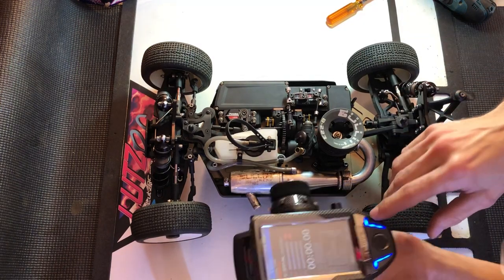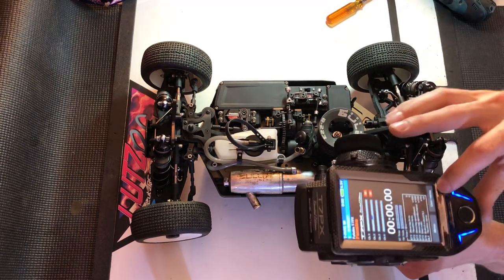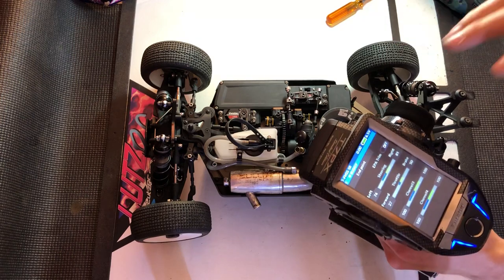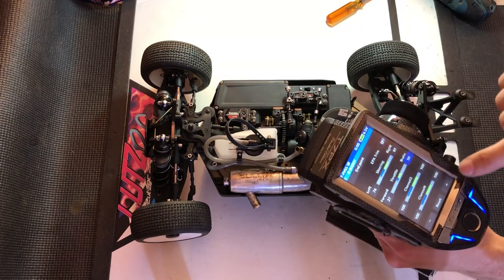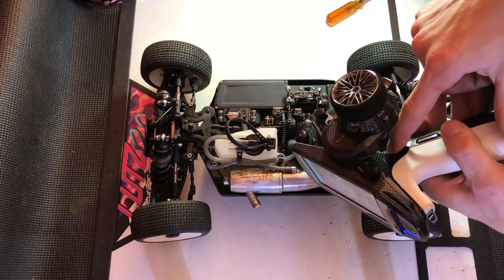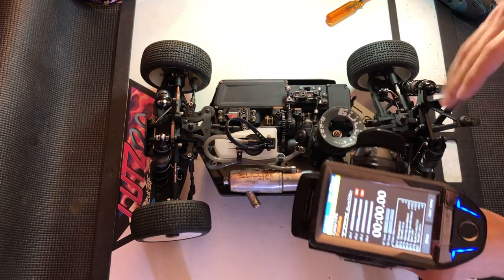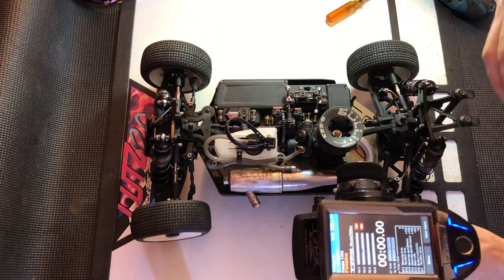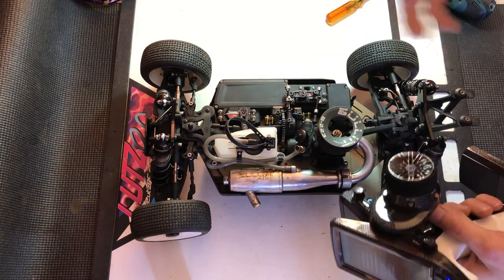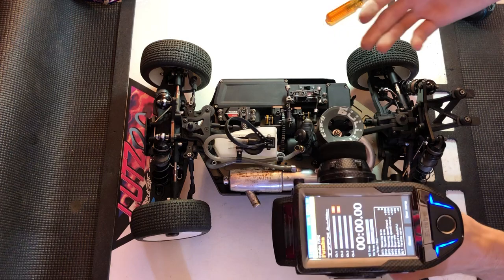Now the end point — what I like to do is that's your overall force. If you add more end point, you're going to increase your front and rear force equally. I like to go to the user menu, end point, and then your brakes. Once I have my end point set exactly how I want it, I'll actually bump my end point up 10 points. Then I go back and I have on my thumb dial a brake end point — they call it the brake one rate ATL — so I'll knock that down 10 points. That puts me back exactly how I liked it, but now I have 10 points to play with while I'm on the track. So if I go out there and my pit guy gets fuel on the brakes and I lose some braking power, I can quickly, as I'm driving, dial it in with my thumb and add some extra clicks in and get my braking power back.